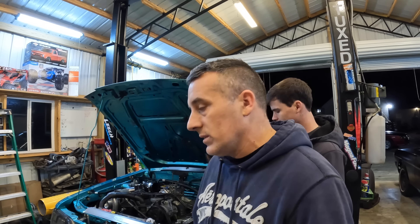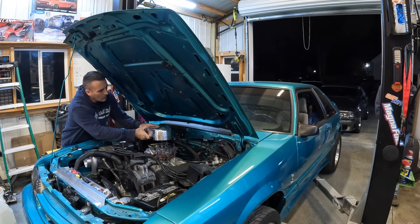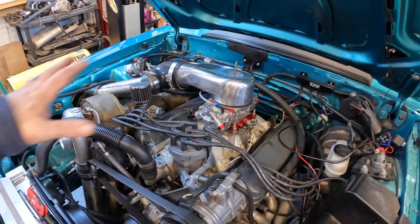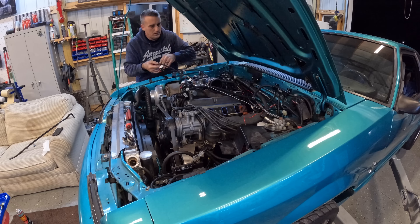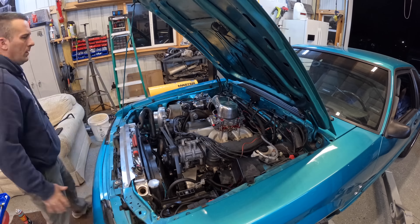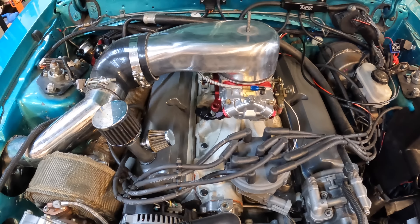But before we go, I'm just going to kind of pan over everything. I'll show you the car with the bonnet on it because it actually does fit — so that was good, I thought it might. We got to remember not to shut the hood because we're going to poke a hole through the top of it if we do. Just drill a hole in the center of the hood and put a wing nut on top — that would be like a hood pin. I think this is going to look nice. What I wanted to show you was just how simple this was — you saw me pull the EFI intake off and literally immediately set down the carbureted intake and throw the carburetor on it. That's just how easy it is. Then all you got to do is bolt everything up, get your fuel set and you're good to go.